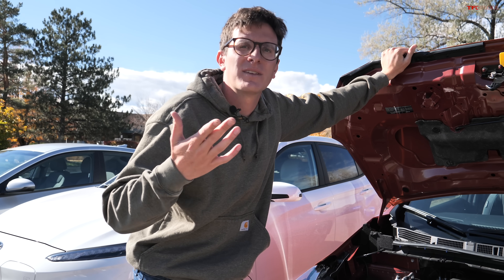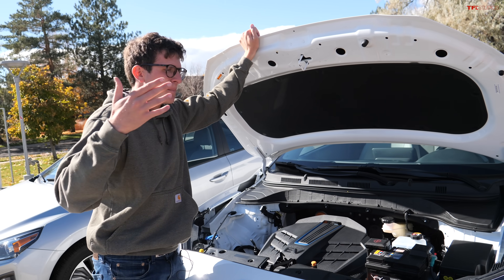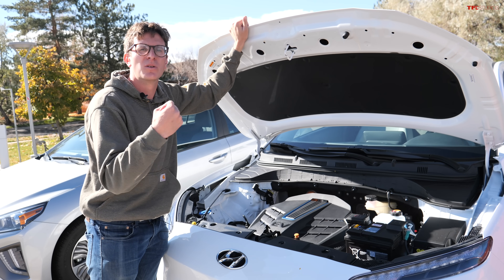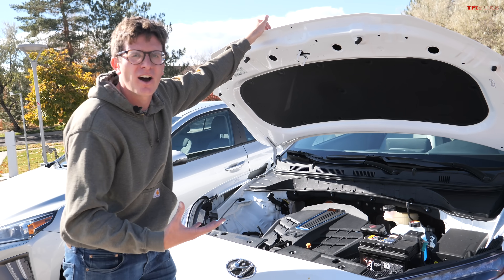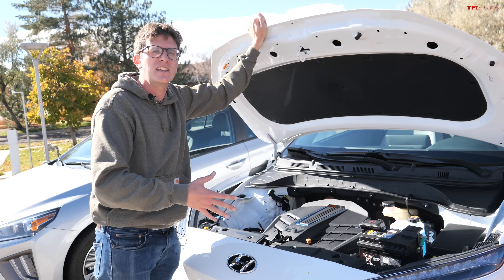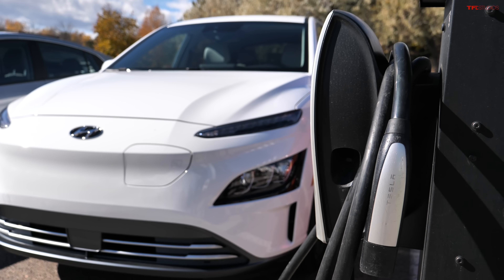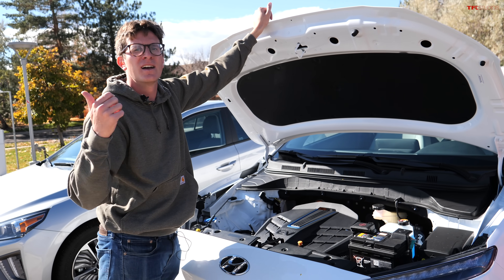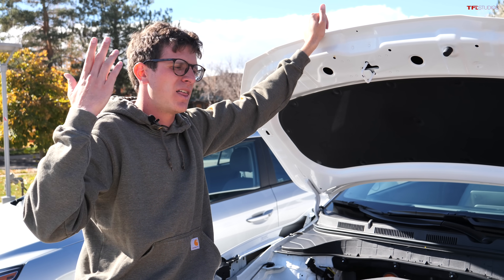When you're going with DC, something different entirely happens. With DC charging at those really fast speeds, you're basically bypassing the onboard charger and taking super-high-current electricity and jamming it directly into the battery pack. There has to be a handshake between the car and the charger — the car says 'I can accept 50 kilowatts,' and the charger says 'I can output 350 kilowatts, but since you can only accept 50, have 50.' It's a much more technically challenging process, and this communication happens via the CHAdeMO port on a Nissan, the CCS port on the Hyundai, and the Tesla port on a Tesla. Currently, Tesla does not allow non-Teslas to charge at Superchargers — there's no handshake that happens.